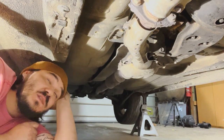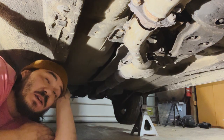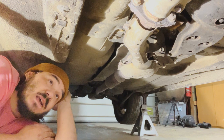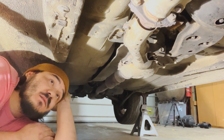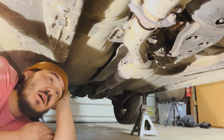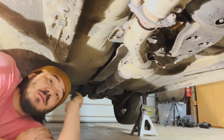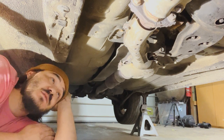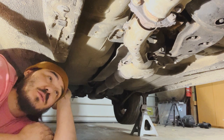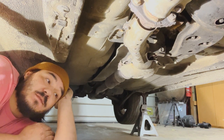Car's jacked up. These bolts are super rusted, especially on the heat shield itself. The heat shield is really just to contain the heat to get the cat going, because the cat's got to warm up before it can actually burn off the exhaust. So we're going to take that shield off — probably just permanently. Looks like I'm probably going to need some donuts, some gaskets. As soon as I get it off I can already see they're real eroded. Let's see if I can break these nuts loose without breaking any of them.